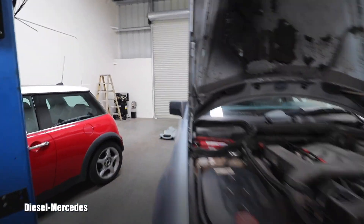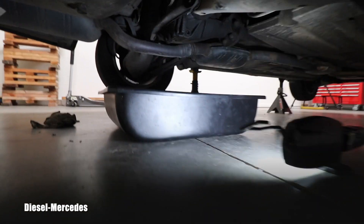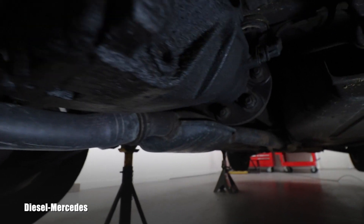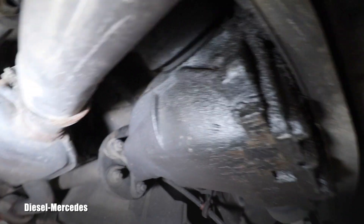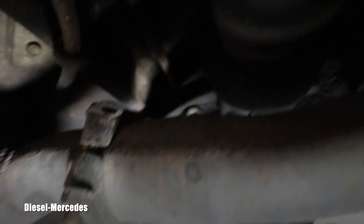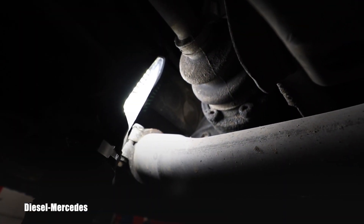As in many Mercedes-Benz, the rear differential bolts on this one are on opposite sides. I put the light here for you, and the catching pan is on the passenger side. If you look closely, there is a bolt on the very bottom — that means this is the drain. Looking at the differential from the back, the filler plug is right there, though the exhaust pipe is nicely in the way.